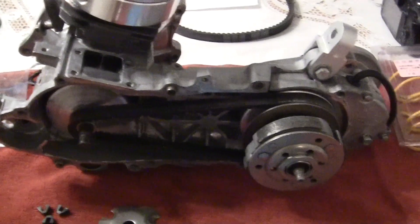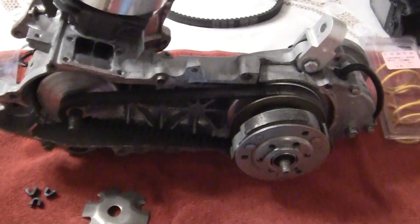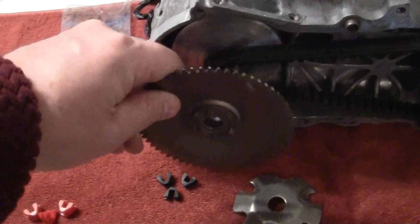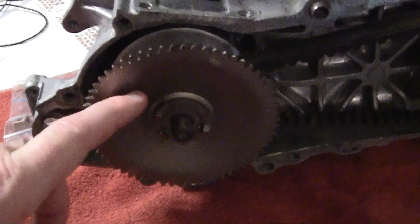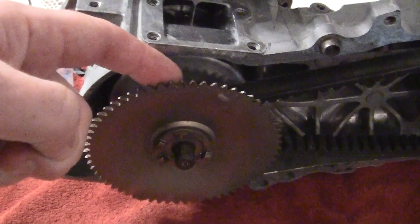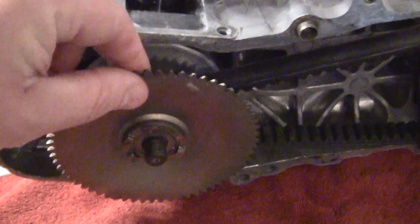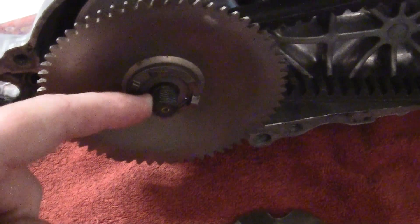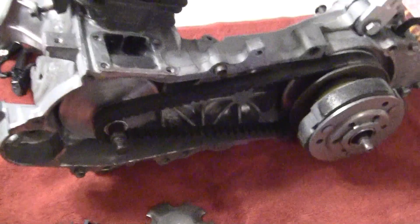With a motor like this, if your belt slips or stretches too far, it's no good. I have taken off these drive faces and found a big blue and yellow burn mark in there. What happens is the belt stretches and it's supposed to be up at high speed, but it stretches so much that it warbles. When it warbles, it catches this part right here and will actually unscrew the locking bolt — that's why I use red Loctite on there. I've walked home many times because of that.